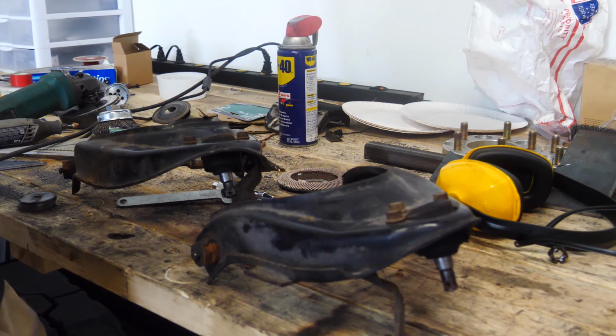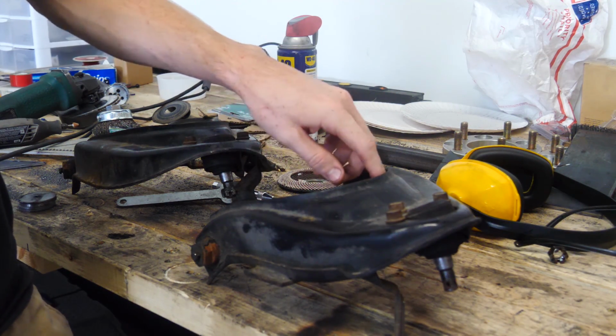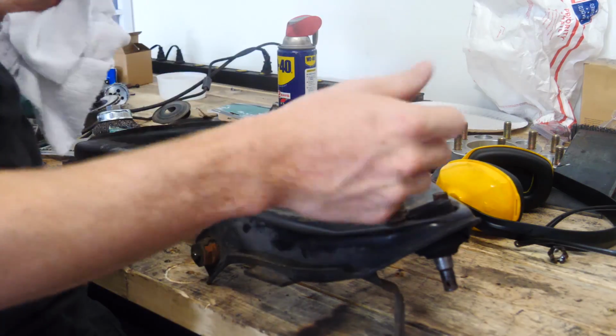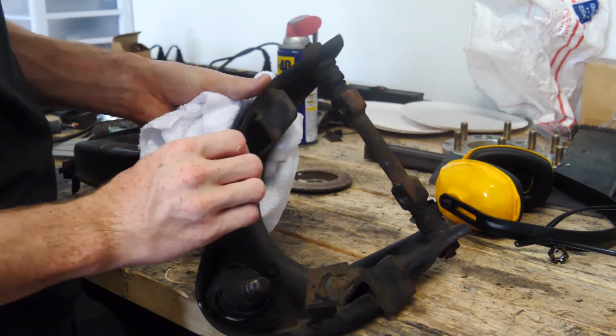We want to be able to add some camber so our wheels are fitted. Now the problem is that the coilover, the spring is already really close to this little lip here. So we're gonna go ahead and cut that lip off, and then eventually, not now because I don't have gas, I'll weld a support on the bottom side.